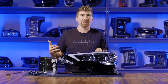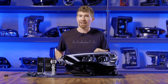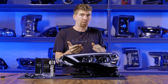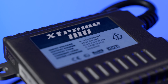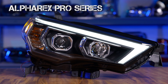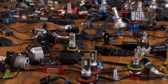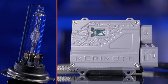Now, why are we upgrading to HID and not recommending an LED bulb? With the Alpha-X headlights, it's really hard to get an LED bulb that's worth it in here — there's just not enough room. You can use a really small LED bulb, but even that doesn't give you an upgrade over your original light. Our recommendation is to definitely use an HID bulb. Most LED headlight bulbs don't fit in the Alpha-X Pro headlights because the projectors are too small, so the only option you're left with is HID.